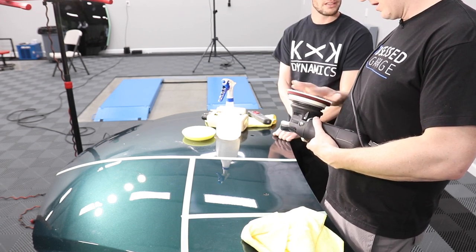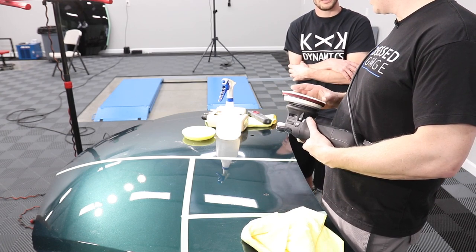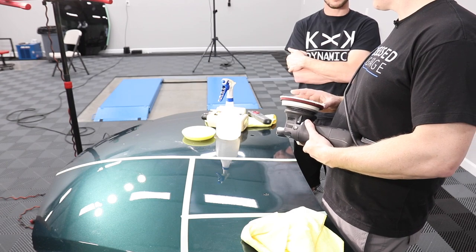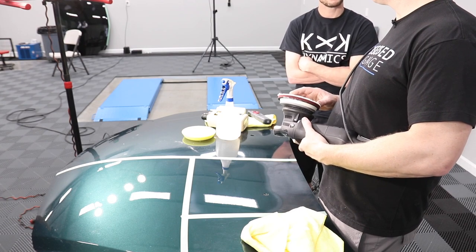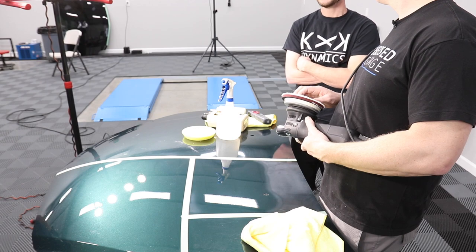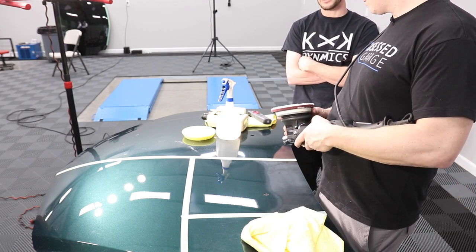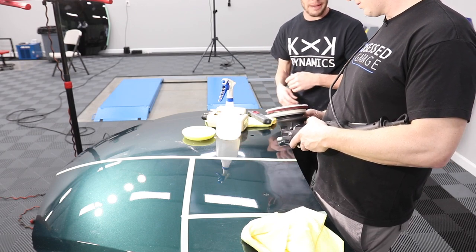Some serious cutting. Now, the first thing I noticed in 101, and I've used it a couple of times, no, I used M100. M100 is the blue one. Very similar. This is the big brother. But generally, you would use M100 on a rotary and M101 on a microfiber. I know I'm generalizing. 101 was designed for rotary and foam. 100 was designed for rotary and wool. But we've adapted through the years and been able to come up with new ways.